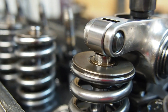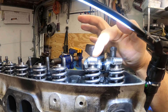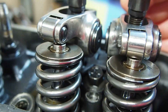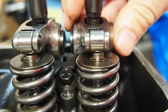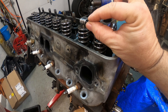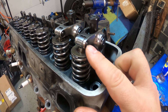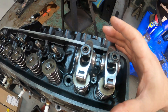I'm amazed at how well they fit already right out of the box. This one is coming out a little tighter than I want, but remember the head gasket's not on here - you get that additional thousandths of an inch once the head comes up. That's what I was counting on in my calculations. With the stock push rod it's perfect. We'll get into more detail about how to do this and how to set up the valve train.